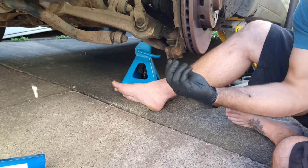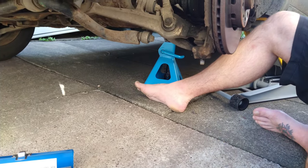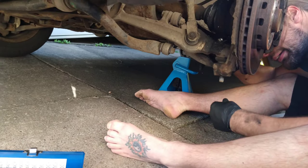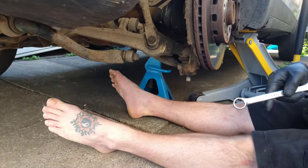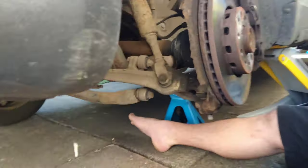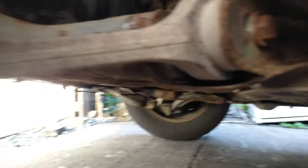There's the first one. In case you're wondering about the sizes, they're 18 millimeter and it was a 14 millimeter hex for the drive shaft bolt. Now I'm going to undo the other one. Because I've not got the other side jacked up, I can't turn the steering, but that's okay. I'm going to double up with the spanner on that one — crack it loose. I'll undo the upside-down one and then loosen this bolt here, and the nut just down there, so the arm can swing down out of the way.